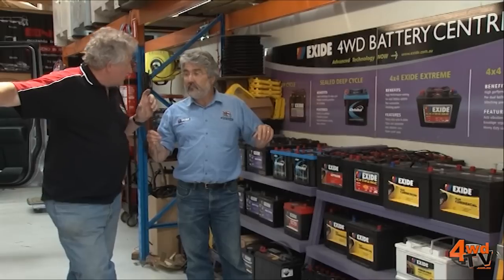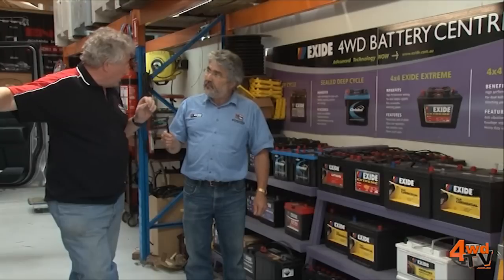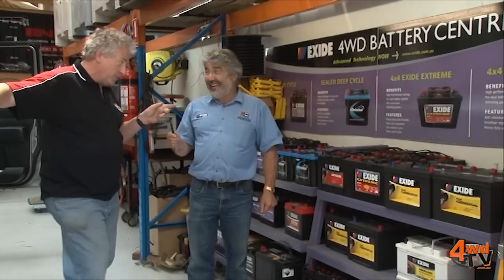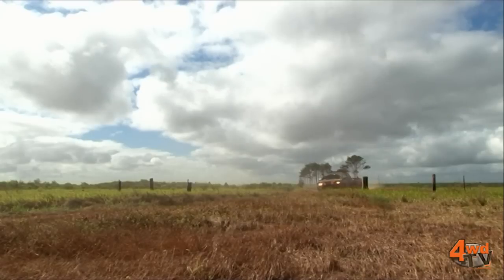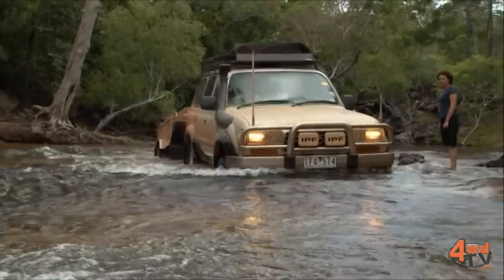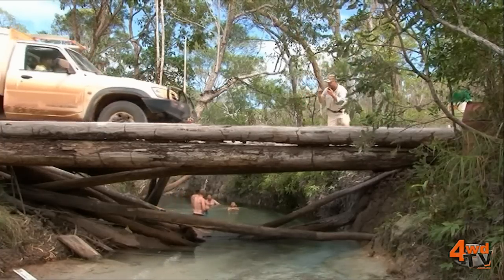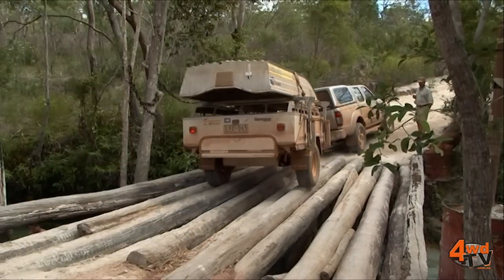When charging these batteries there are different characteristics — some require higher voltage than others, so not all of them will match together. In the traditional sense of parallel charging, when we match up one or two batteries on the auxiliary, we would like to have them the same. They've got to be similar capacity and similar technology — and this is not an old wives' tale. You will not get a satisfactory charge and you will not get an optimum rate.